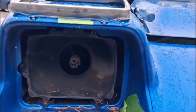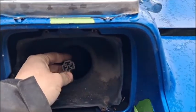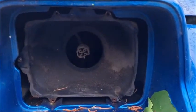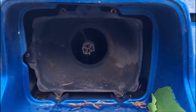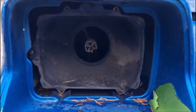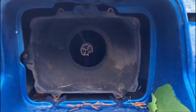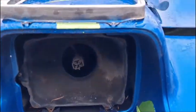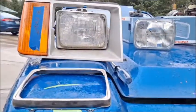After that, you're done. It is wise, since you've got these out, to put dielectric grease on these connectors. The oldest ones are going to be 42 years old right now, and even the younger ones — we're talking 1990 — are still 32 years old. So it's a good idea to put dielectric grease on those to help them live a long life and help prevent problems for you in the future.